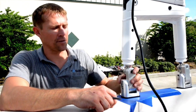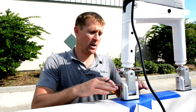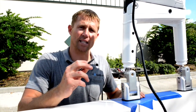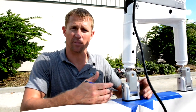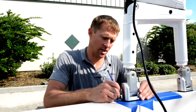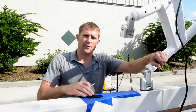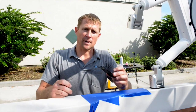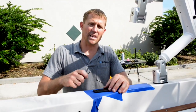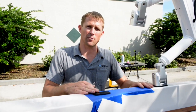We temporarily mounted the front feet onto the base of the tower without the studs so the feet lay flat on our blue tape. I can take a pencil and trace the outline of the subplate to locate the front feet exactly where we want them. Now I take my subplate, set it in place, and center-punch the two holes.